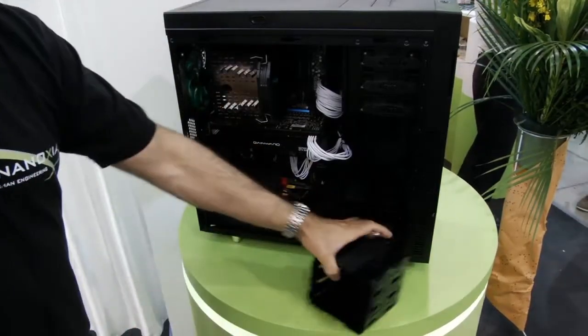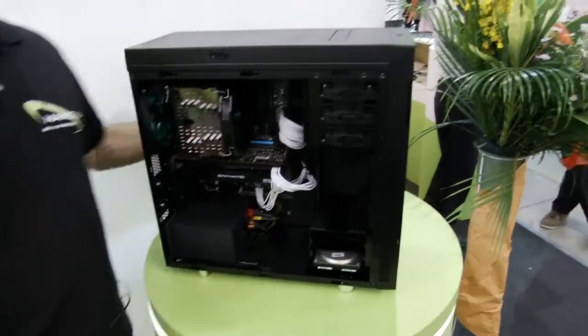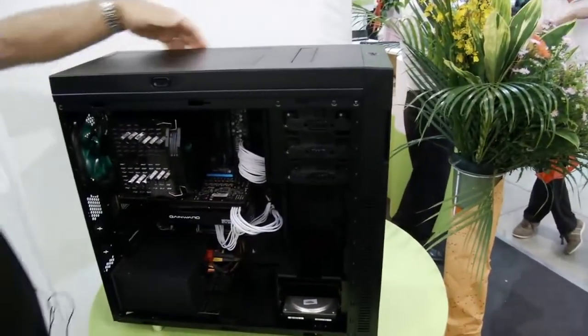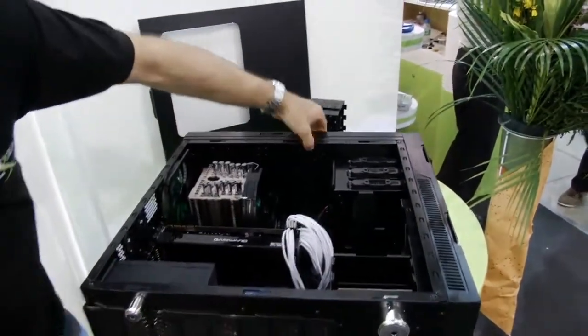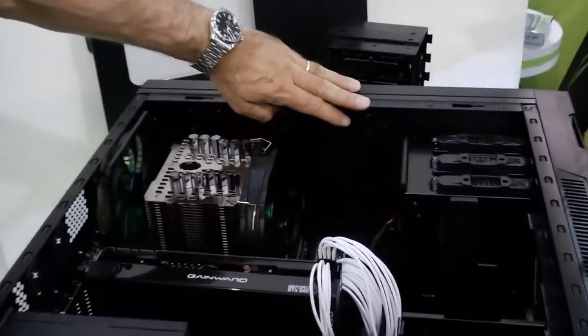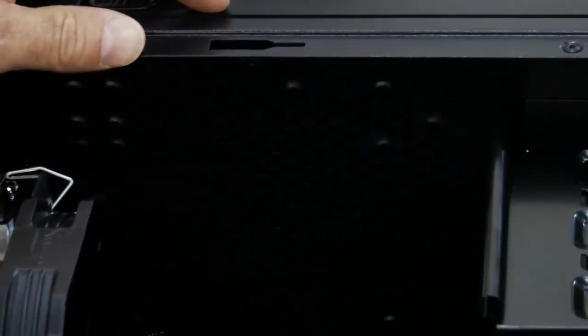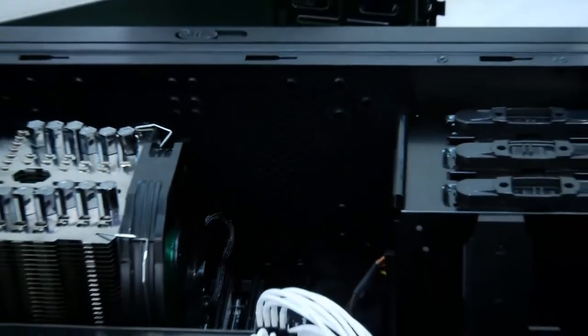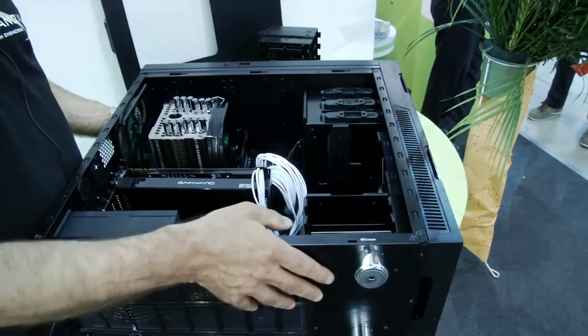On top of the case, although it's 220mm wide, normally you do not find enough space to mount a 240mm radiator. That's why we added a lot of additional mounting holes so that a radiator can be mounted towards the left side panel, so you got much more space. So even 45mm thick radiators will fit, up to 240mm. So from this point of view, the case is very flexible, and we received a lot of attraction from customers all over the world, especially from the US market so far.